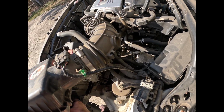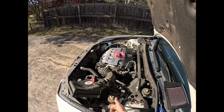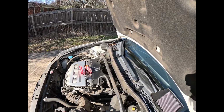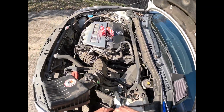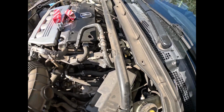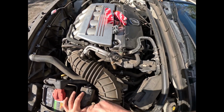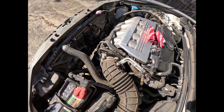Again, it is going to go clockwise, just like on the other side. Alright, so after you get that cover in, you can just go ahead and grab your air box and slide that on in there. And you can start by sliding that one in, just to have it as a face plate. Go ahead and grab your 10mm, move this over so we can see it. It's down in there. I'm gonna have to probably move the box around a little bit until you catch the threads.